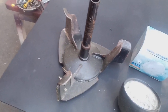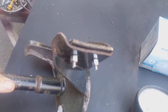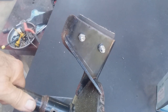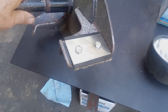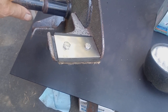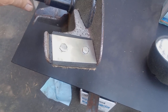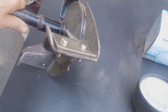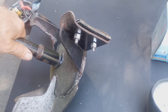Your next upgrade is an impeller kit. Rubber pads are installed on your impeller, which will help you throw snow farther and cut down on clogging issues. This is a game changer — it can really, really help, especially if you get a lot of wet, slushy snow in your area. It really makes a big difference. You can make your own kit for a couple bucks, or you can buy it on Amazon or eBay for about $35 and install it yourself. Watch our video in the playlist for instructions, or have somebody install it for you.